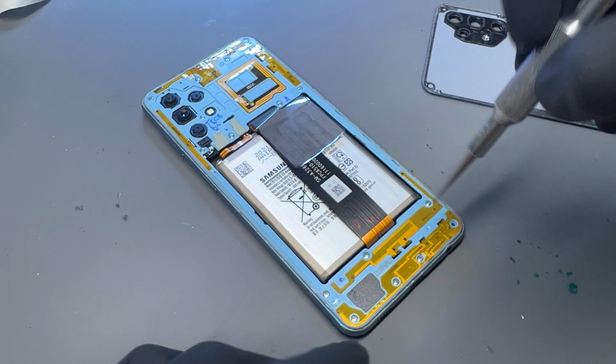Where we just took the SIM tray out of, that's the weakest point in the plastic. Insert a plastic pick into there and work your way around like that. Be careful around the lock button because that's got a fingerprint sensor on it and you don't want to snag that cable there. But once that's removed, once all the plastic is pried away, oh, we've missed a screw.